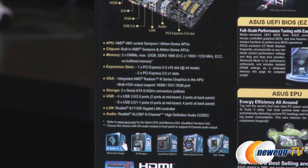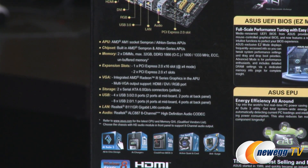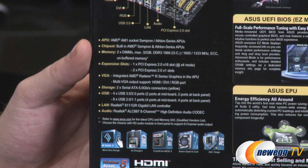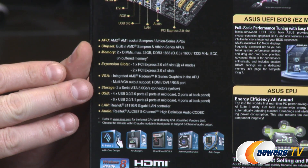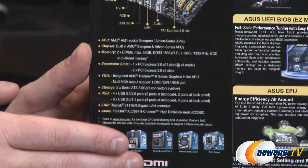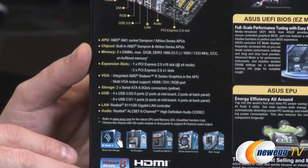Kabini is actually designed by AMD for market regions that have lower GDP — at least that's something they've stated. So this is a very budget-friendly and power-friendly platform. Users in these markets have asked for really low cost systems that also maintain upgradability. AMD is not really seeing these systems being used with anything other than a low-end discrete graphics card. As far as lane support, you have four-speed PCI Express lanes on this board, so this isn't really designed for a gaming platform. This is more for a low cost, low power solution.